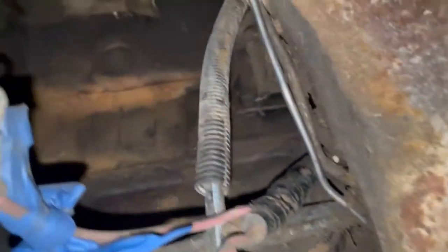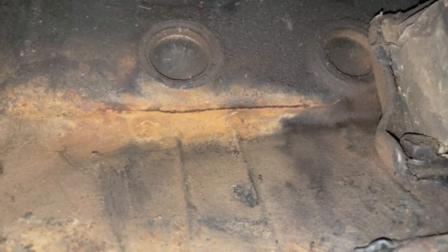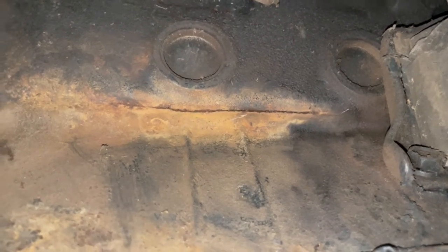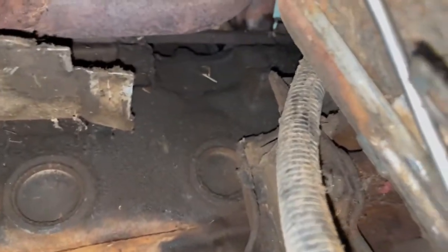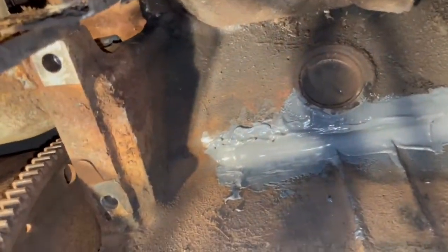It's going to cost me about five dollars to try it, but if I can apply some epoxy there to stop that leak I think I can get away with it. This crack is long — maybe four inches — and it starts to spew at five psi, so it may be a long shot. But what I'm looking to do is get the car out on the road and enjoy how it drives during the summer and fall, then use the winter to rebuild it and make it better than ever. It's not a final solution at all, just to get it out and enjoy it for now while I plan my winter accordingly.